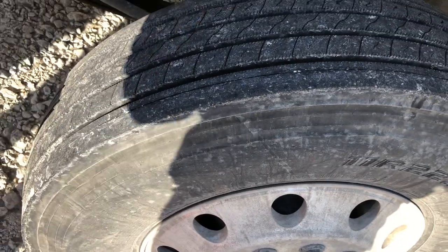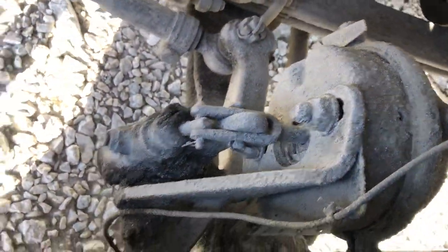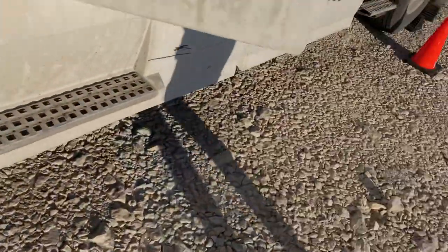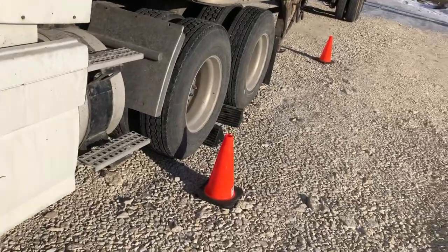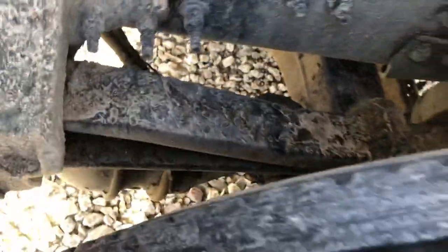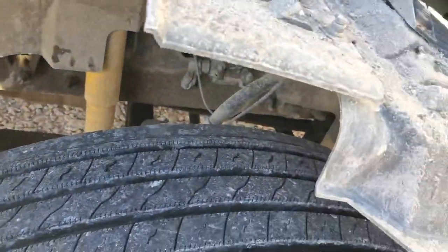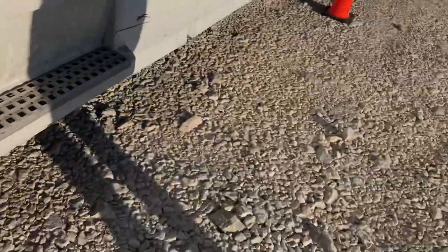In the front we have a type 20 brake chamber with a short stroke push rod - that push rod comes out a maximum of 1.75 inches. On the drive axle and the trailer axle we have a type 30 brake chamber, a dual brake chamber with a short stroke push rod that comes out around 2 inches; if long stroke, about 2.5 to 3 inches. On the same axle, the measurement difference between sides should not be more than a quarter inch. I will check all brake chambers the same way and verify against manufacturer specifications.